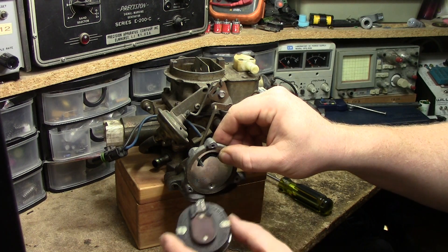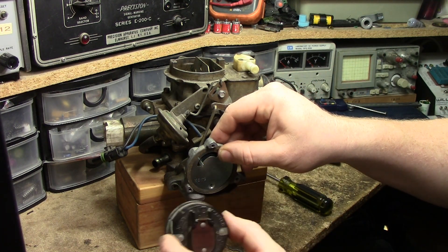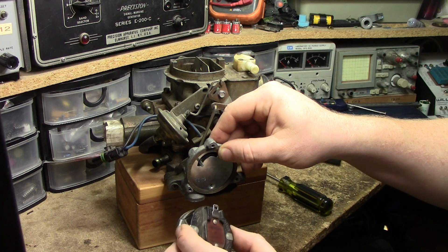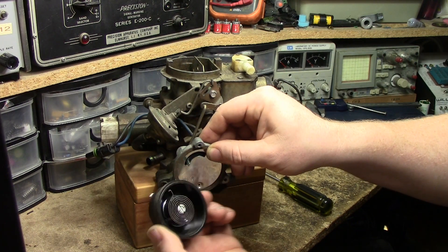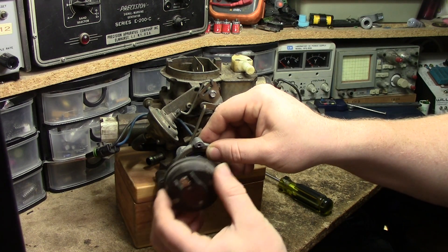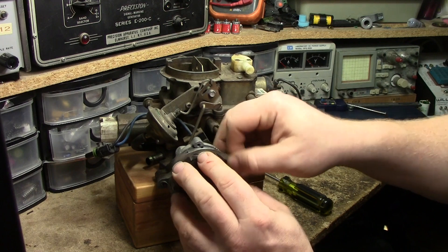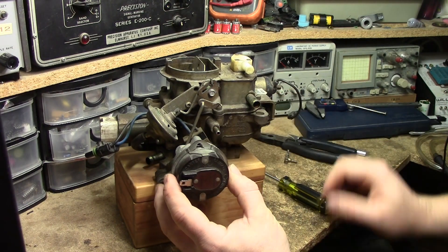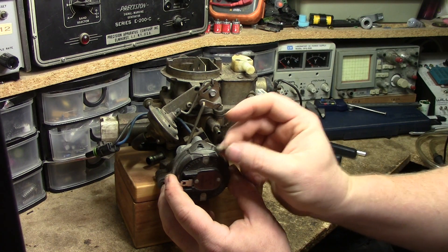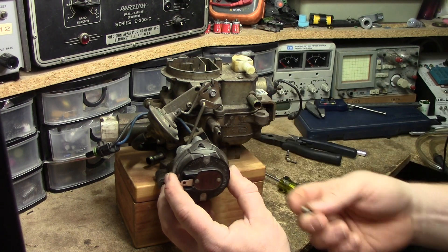The aftermarket ones — I'm not entirely sure about where the terminal is. What we want to do is, with the vehicle and the housing cooled off to ambient temperatures and not having been operated in hours, we can make this adjustment. So as you can see with the terminal at the 12 o'clock position, that is where the coil sits inside. I'm going to go to the 9 o'clock position and put on the housing cover. Before you even got this off — if it was already installed — you may have had to deal with these security screws that some regions require. The instructions are to grind a slot through them and remove them with a screwdriver.